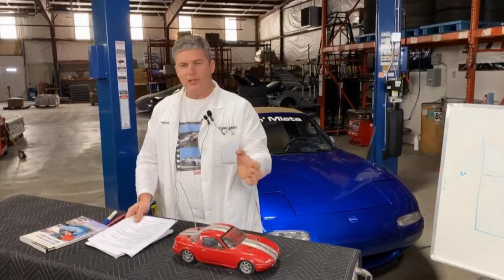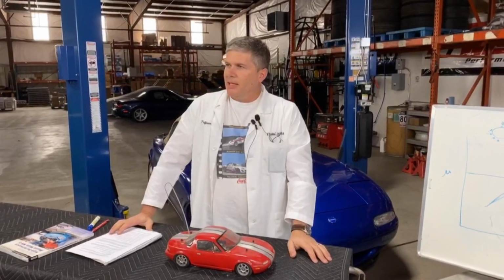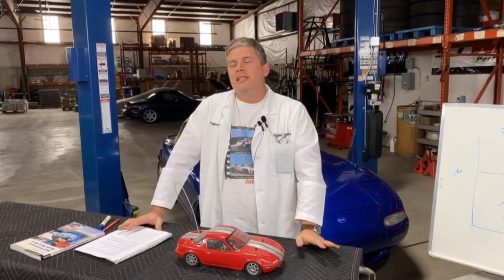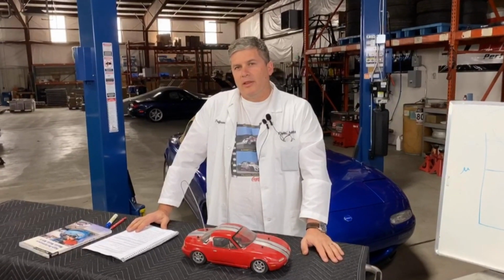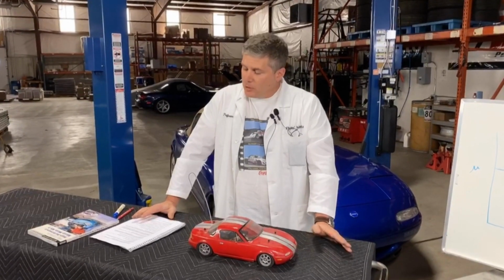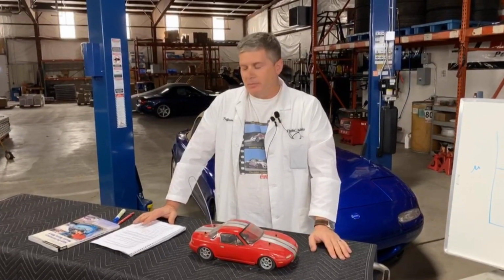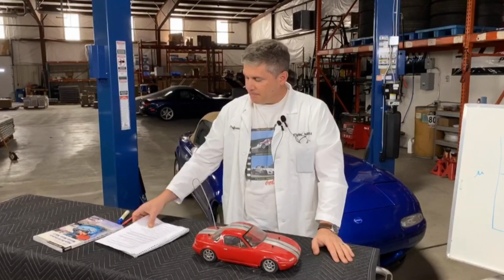They've got the same suspension. They're both running factory wheels and tires. And he brought it back and said that there's a significant difference in brake feel on the car with the little big brake kit with our Wilwoods on it. And that's due to the stiffness of the caliper, I think. It could be due to our sizing choices, but whatever, there is definitely a difference. Plus it weighs 15 pounds less, which is a nice little bonus. But yes, in that case there is.